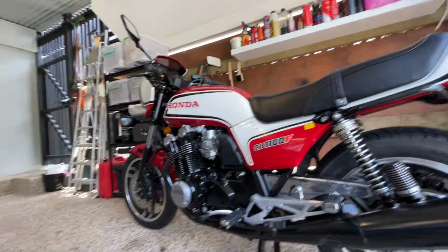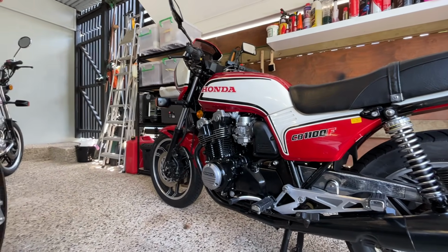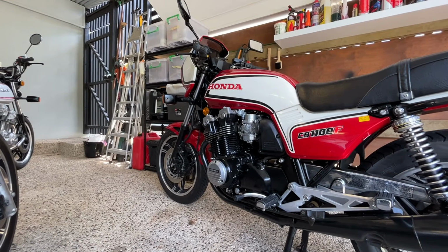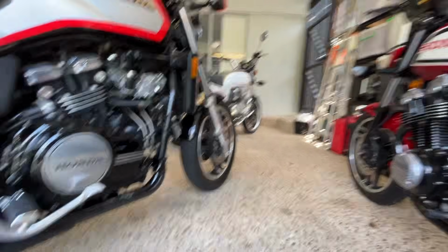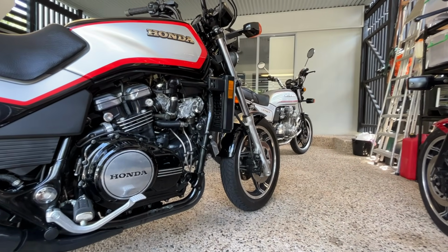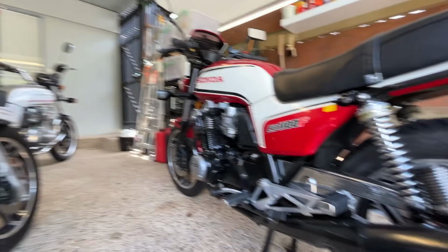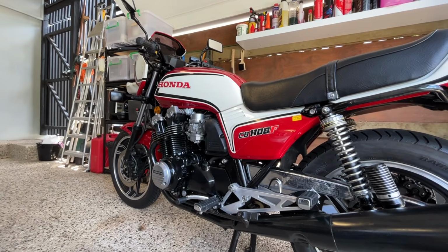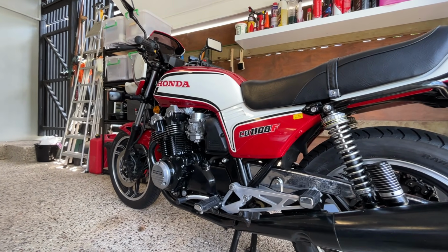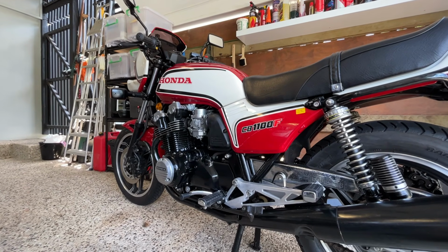I think it's the geometry, the frame geometry on the 1100F is different. The forks are shallower rake and shallower in length, as opposed to the longer, more cruisy-like forks and the longer rake on the V65. This 1100F loves to be ridden into corners, out of corners, loves the twisties, nimble, very predictable the way it handles, and really wants you to ride it.